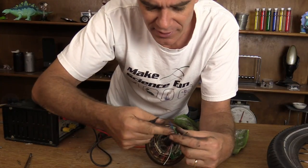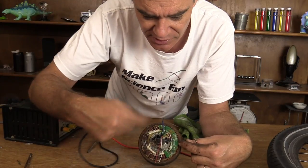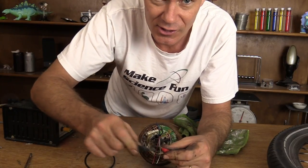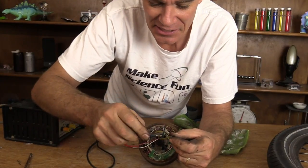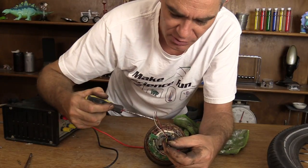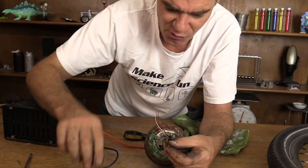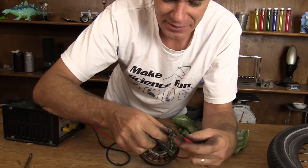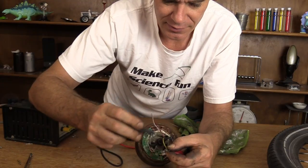So what I've done is I've stripped the wires. There are three that probably go to some sensors - likely Hall effect sensors in there that measure the magnetic field and position. And these three wires are connected to the coils in a particular order. I've got a little 12 volt source and I might just try connecting the coils up at random and see what happens. As you power up these coils, they produce a magnetic field, and that magnetic field opposes the permanent magnets of the rotor causing it to turn. I think the permanent magnets of this rotor are quite weak, so the force isn't that great. But - I can get this motor to turn! Not to run, but at least a turn. Look at that!